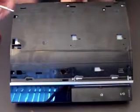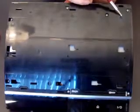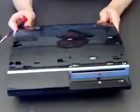The top of the console has seven screws: six long and one short. The short screw is located here and Sony have very kindly marked it with an 'S' — I'm not sure if you'll see that on the video but once you open your console up you'll see it. It's on the top right-hand corner, and the reason it's a smaller screw is because at that point the console is quite thin. I've already loosened these screws up so you don't have to waste time watching me unscrew them, so I'll just loosen them off the last little bit.